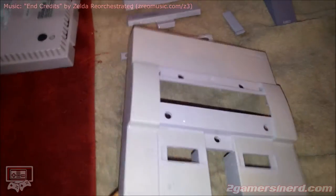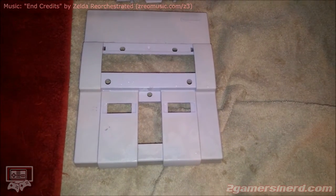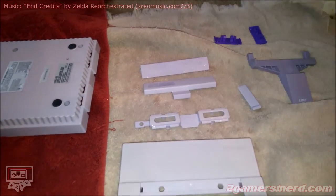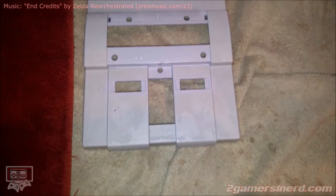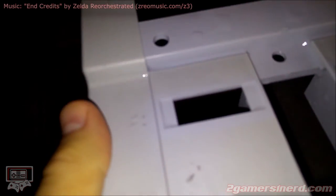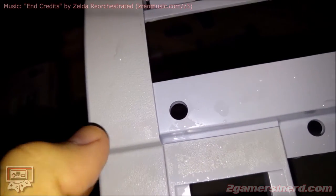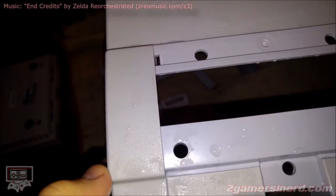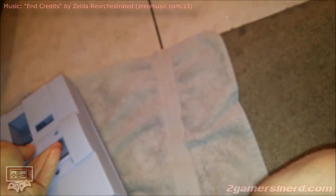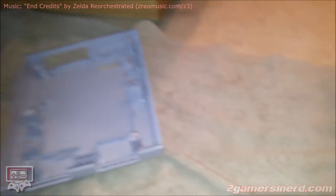So far so good. But if you look at it, you can still see just a little bit of discoloration. Just off this result right here, I'm already 100% pleased. However, since we do have some daylight left — which means we still have UV left — I'm going to soak this in hydrogen peroxide and change locations and let it sit for a few more hours to maximize the results. I don't know if you can see it anymore. This was really, really discolored when we first started. You can still see the original gray on this side versus the yellowed side, but it's really difficult to make out now. You could reassemble this and honestly you would never know it wasn't just a really good, in-shape Super Nintendo. We're going to put them back out for a couple more hours.